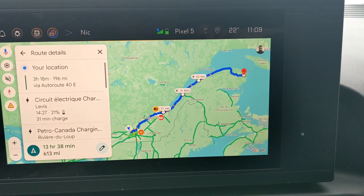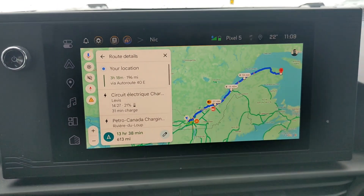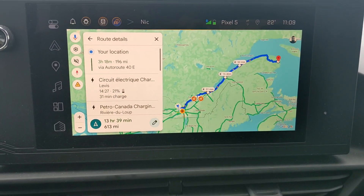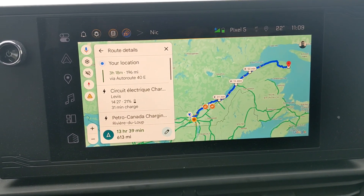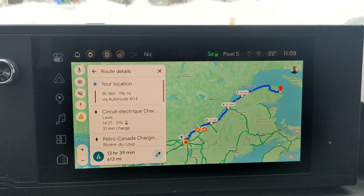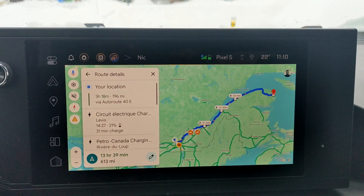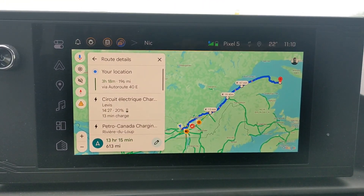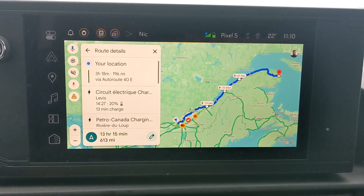It tells me lots of useful info nearby at each stop. As far as I know, when your destination in Google Maps is a charging station, it should automatically pre-condition the battery if needed. What pre-conditioning means is: if your battery pack is cold, power flow is less efficient. So about 20 minutes before you arrive at the charging station, the system will start heating the battery pack if it's very cold outside, targeting around 20 degrees Celsius.